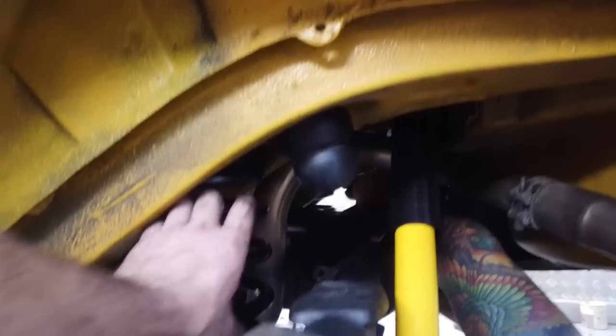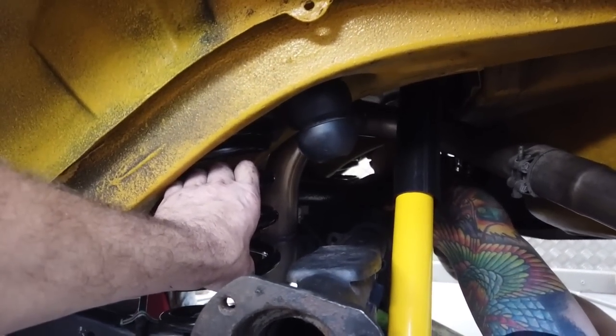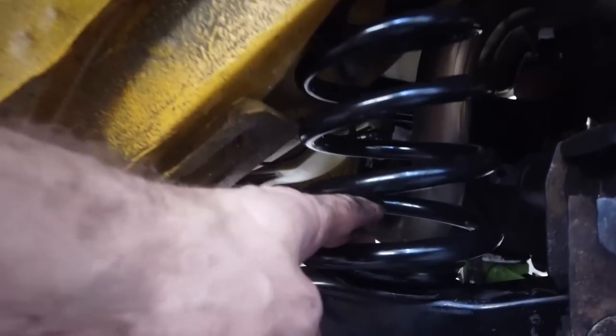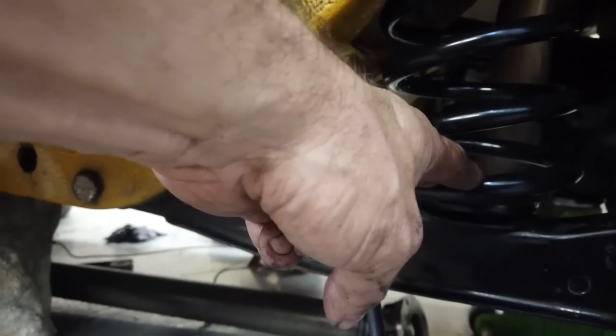Make sure your springs seat in the correct orientation into the chassis fork, because there is an indent to receive the shape of the end of the spring. And on my car anyway, you have these cups which lock the spring on at the bottom. Not all cars have them. Some just rest off pressure. These early ones have a locking plate. You can just see it. And that clamps the spring down to the lower radius arm.